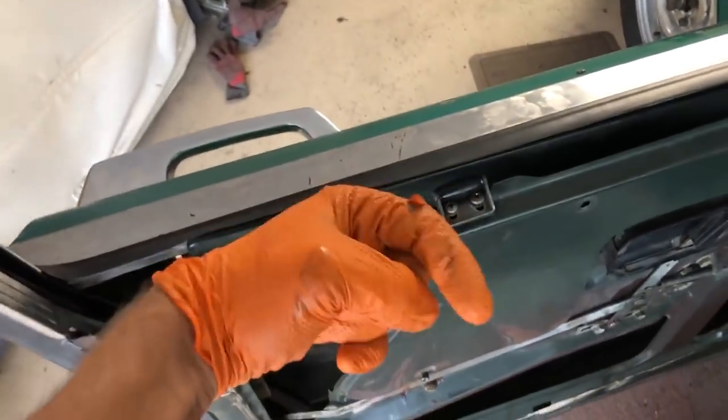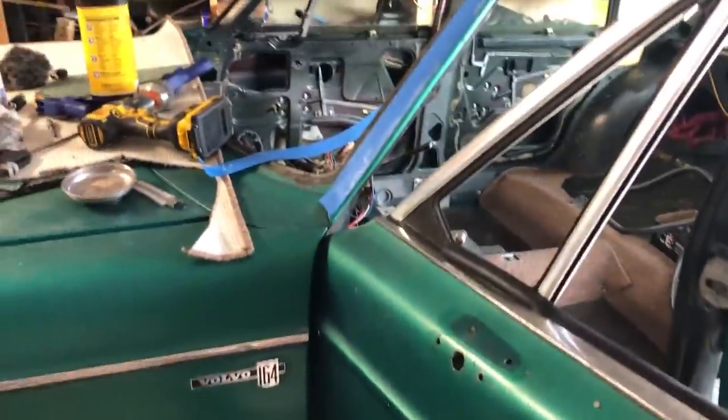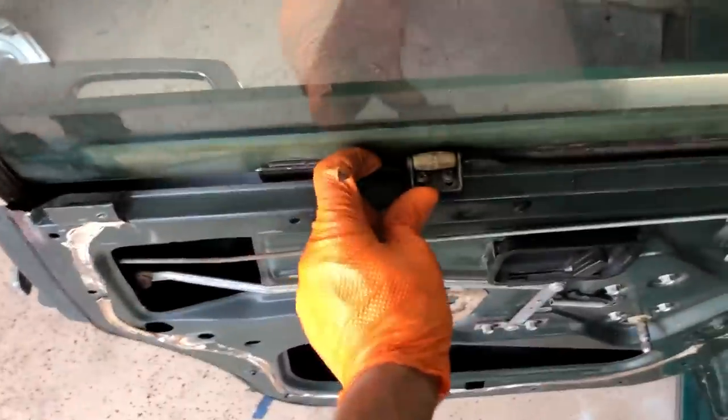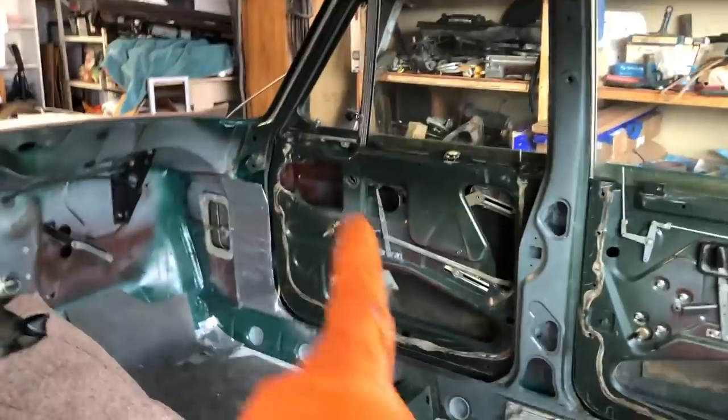This is adjusted all the way toward me, but I think the whole thing's a little funky because of whoever punched that out. There was drama with the door limiter, you see the new bolt here, which was not working before, and that's, as we know, the cause of the trim being destroyed. Thankfully, not too many dents in the door. Woo! Love that. This one here, I loosened it, and I see that it was all the way forward. Now I've put it all the way back, and there's plenty of room. So I'm guessing it is just because the line of the door may be slightly affected by the modification on that speaker hole that was punched out very inappropriately.